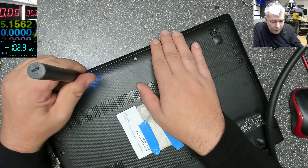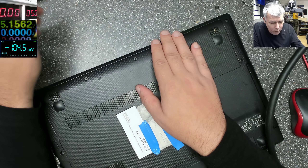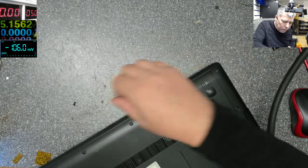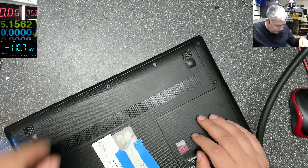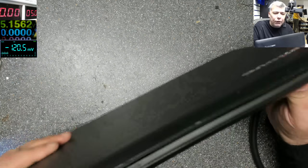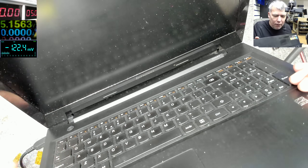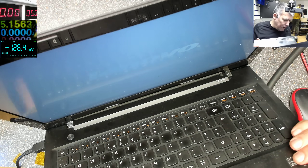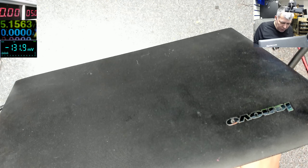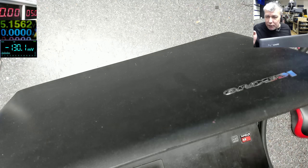Let's get another job. I should have tried from the beginning to take out the battery and plug it back. Let's plug the charger. I can see the LED from the power, and if I press the power button now, probably the laptop is coming on — and it is coming on. The battery is charged, so it's working without the charger as well. Clearly the BIOS was frozen.